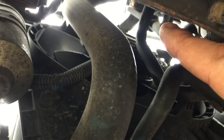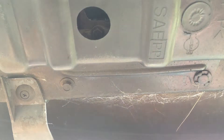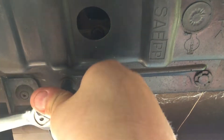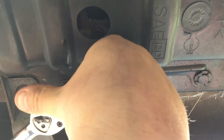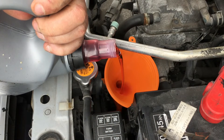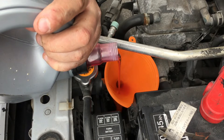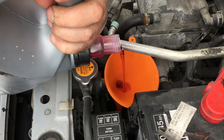There are two coolant pipes going to the transmission — they go to a little heat exchanger at the bottom of the radiator. One goes into the bottom of the transmission and another into the top. There's a small under-shield in the way of the radiator, so while I waited for the fluid to drain I undid the single 10-millimetre bolt on that cover and popped out the plastic locating tag on the other side. That gave me access to the radiator. Filling the transmission used the two-funnel method — one funnel into the dipstick tube and a larger funnel feeding into it.